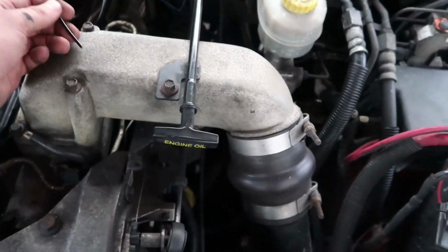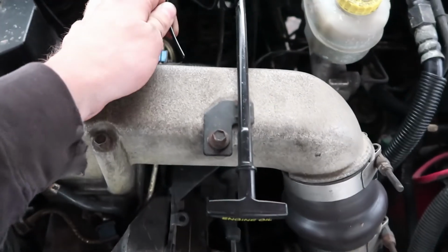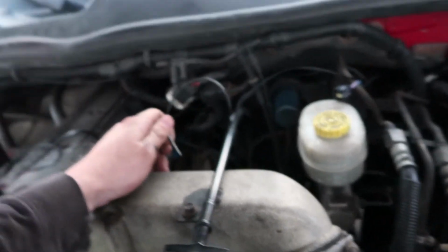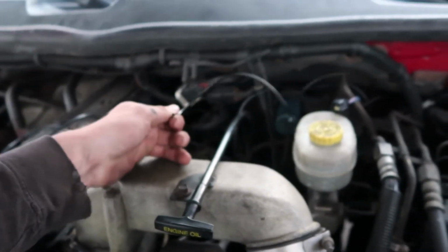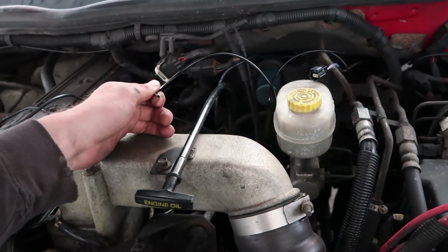And then, like I said, when we get an aftermarket intake horn, we can always put the sensor into the intake horn and have that plugged in right here. So we won't need as much of this line. And the good thing with this boost line is it is basically a plastic vacuum line, so you can clip this down to size.